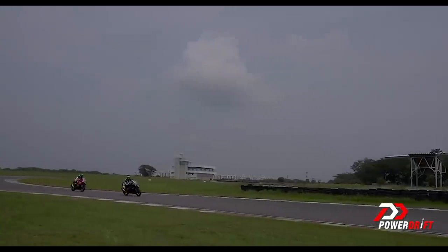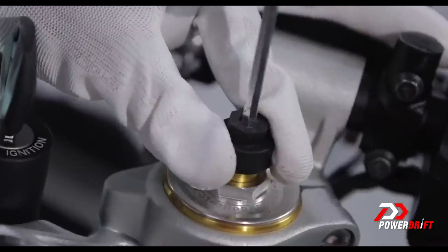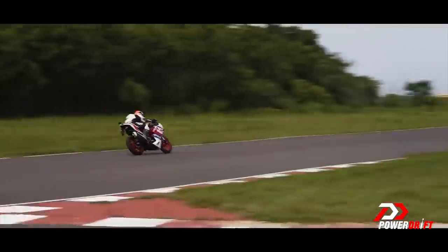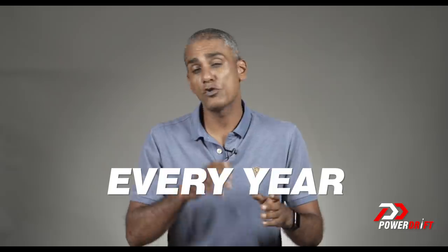What manufacturers do when developing motorcycles is use fully adjustable suspension units on prototypes to play with preload, compression damping, and rebound damping to find the best setting for the average user. The problem is that the average is almost never exactly what you want. So when you change your fork oil — which should be done every year if you ride a lot, or every other year otherwise — you can change the fluid amount by a small amount to adjust your compression.